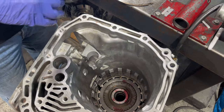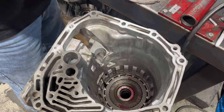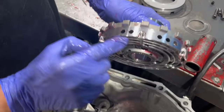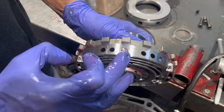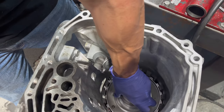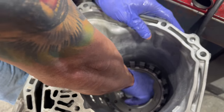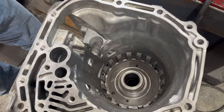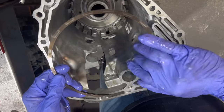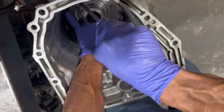Ball that up a little bit. This is a tight fit so it doesn't hurt to put a little oil on here, and a little on the bearings. What we have is three bolt holes, and this middle bolt hole is going to be oriented at 6 o'clock into the transmission. You just have to really gently work this down. Now you see that it's down all the way. Next we're going to put this heavy snap ring in — flat side towards the back, beveled side faces up. I like to put the opening at 6 o'clock. These are kind of a hump to put in.